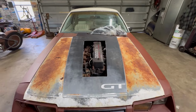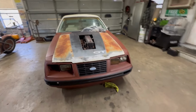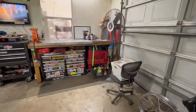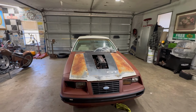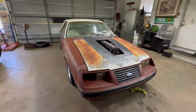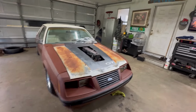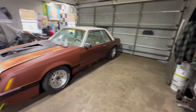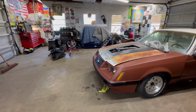It's a first gen motor, but so obviously corresponding with that, it has a first gen oil pan on it, which come to find out are actually shorter than later P pump and 24 valve oil pans in height. They are like an inch and a quarter shorter. So now the oil pan is not as miserably low. Before, that thing would just sit like, you know, half inch off the ground. And that's bad, but now it's up there a little bit. I do think I might actually still shorten it some, you know, whatever. We've got a couple 12 valves sitting around in the shop now.